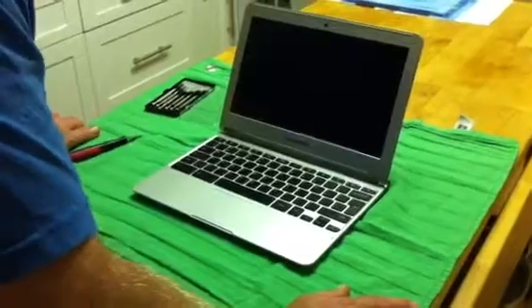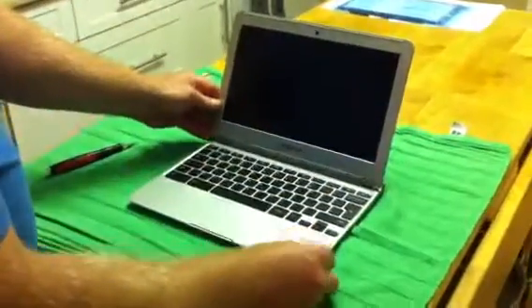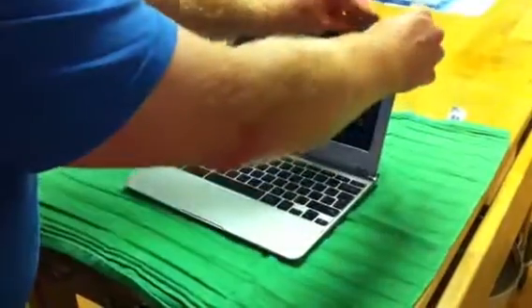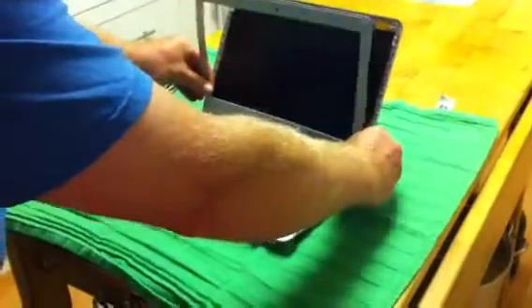The first thing you're going to do is take off the bezel — the front bezel, the top of the screen. It's all plastic and there are absolutely no screws on this part. Just reach your fingers in the middle and you'll see it starts to peel away. Keep peeling little bits at a time. It just pops right out with a little bit of patience.